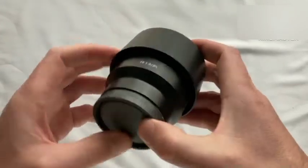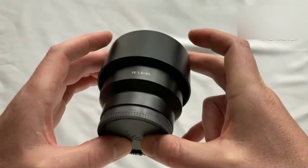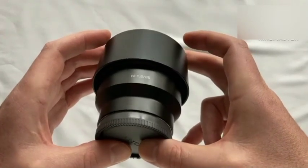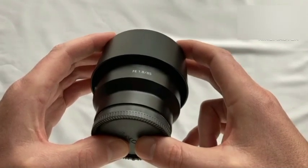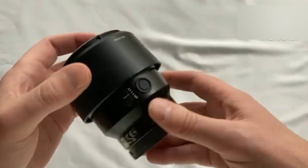The lens may fog up in hot or cold environments. This can occur when the camera is moved from one temperature extreme to the other — most commonly when going from a very cold environment to a very warm one, but it can also happen in reverse. To correct fogging, remove the battery and storage media in a low-humidity environment.